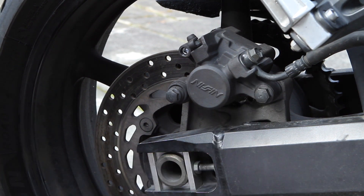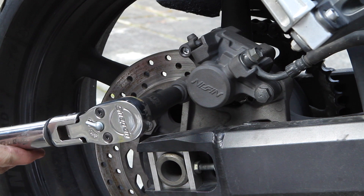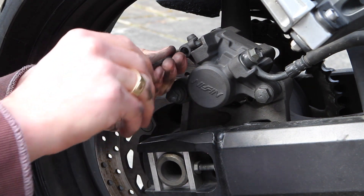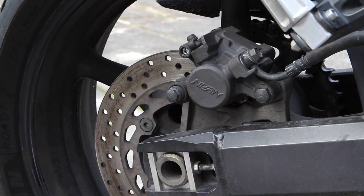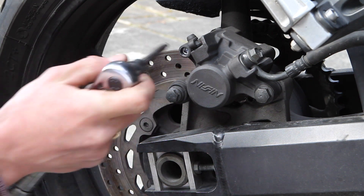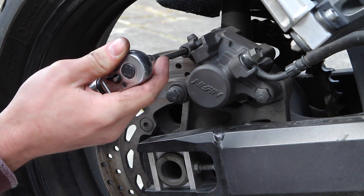I've already got my torque wrench set — torquing the 14 millimeter now, then the 12. Now we're safely torqued. I'm just going to nip this up, make sure it's snug, and then come back with the torque wrench. I have a 5 millimeter allen head on a 3/8 drive, so I'm putting that in there and torquing up to 12 foot-pounds. There you go.